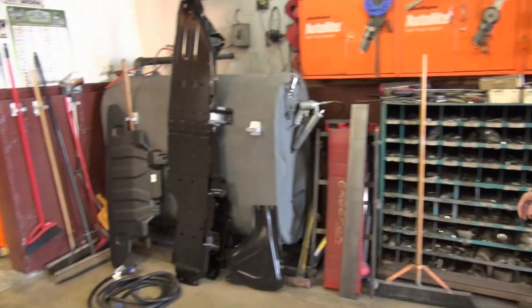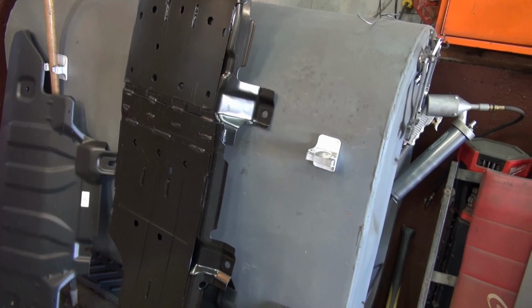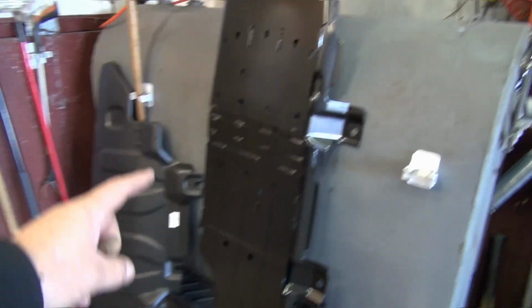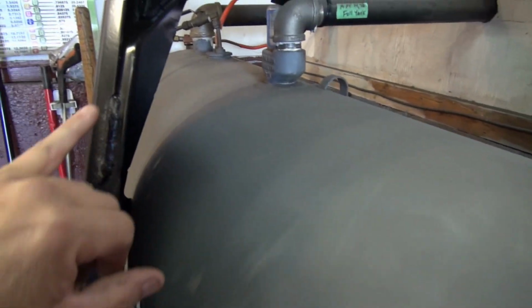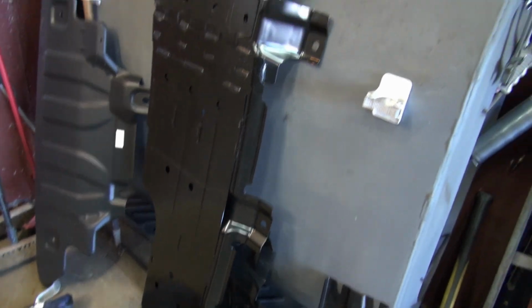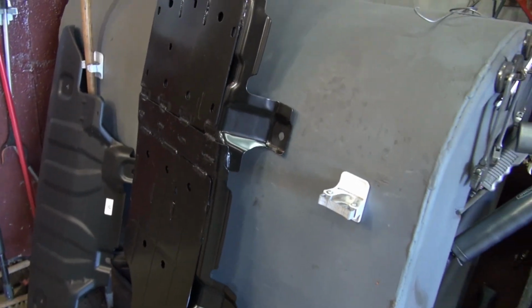Anyway, I'm going to take Billy, the Bronco. So we had to buy four skid pans, because it was cheaper or the same price as buying just this one, in a kit from Ford as OEM. Now, this is doubled up, so this is a quarter here, an eighth here, and an eighth here, which is a quarter all the way through, which is pretty good, but it's all one piece. What I liked about this over the aftermarket is that it's all a pressed type of thing, so it has a tendency to be a bit stronger.